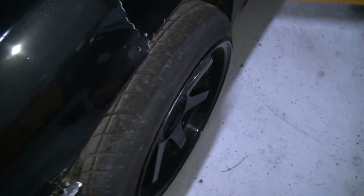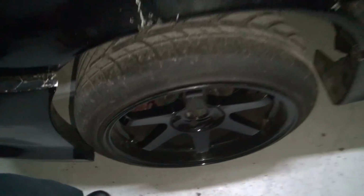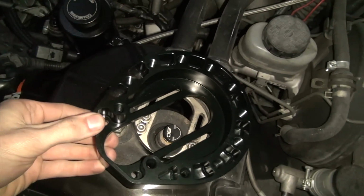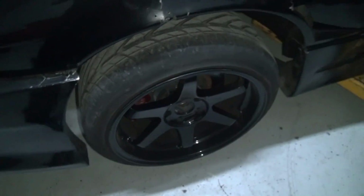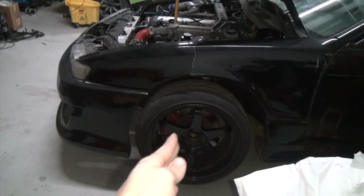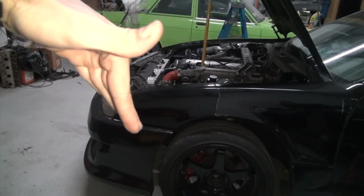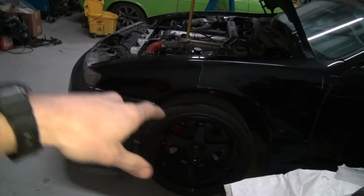So I have a lot of camber in the front, I think it's like 6 or 7 or something like that. But I want to knock it down to somewhere around 5 or so, and then you could also move it over this way as well, and that's kind of how the Wisefab works. Because I have a lot of caster in my setup right now, if you look at the wheel well, there's a little gap over there and a bigger gap over there. So there's a lot of caster, so it's kind of like a shopping cart. If you have the wheel straight up and down, it'll spin like a top, but as soon as you lean it, it wants to stay a certain way, and that's kind of why the tires of these things roll over when you turn the wheel. Let me unlock.